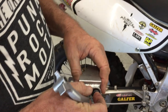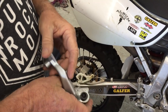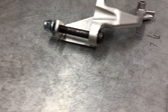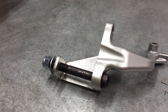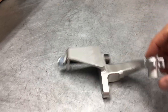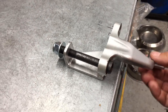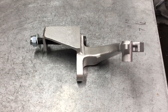But it was only for the guys racing and stuff — jumping, hitting things, hitting G-outs. It just takes a lot of pressure, and they just underestimated how much pressure it could actually hold. It's just bolted straight on the frame, but it starts to rock. And once it starts rocking, most people don't notice it until it's too late. The bolt's rocking in the threads and starting to pull threads out of the bolt holes, and it's just screwed into aluminum.